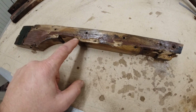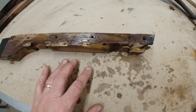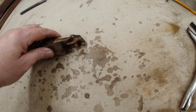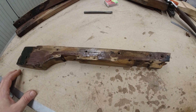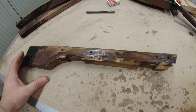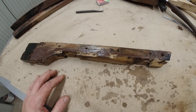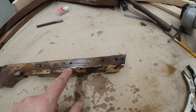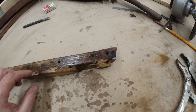There's each area where I went to get the nails or brads out from where the body overlaps, and then there's this area up here that was a little soft and broke when it was coming out of the steel, and this area here too. Normally I would just make a new one of these, but I sort of don't want the car to be a new car — I feel like I'm trying to do it a favor by keeping as much of it original. So I'm going to put the second part, which is actually Bondo — formulated a little differently from regular body filler.